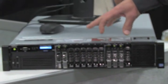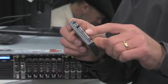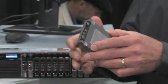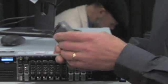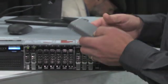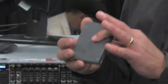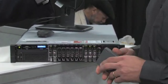We also have over here a server that supports PCI Express at the front of the box. This is a prototype device, and it's got a connector very much like your typical SAS or SATA connector. The difference is it has PCI lanes — four lanes of PCI that connect into the PCI root complex. IT managers see this and think it looks like a drive, acts like a drive — it is storage. That's why Dell built this box and put it at the front of the server, so IT guys can treat it like storage.